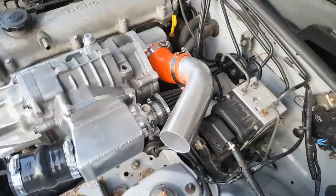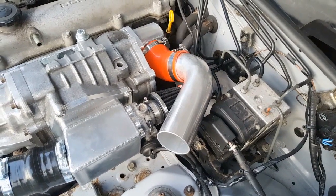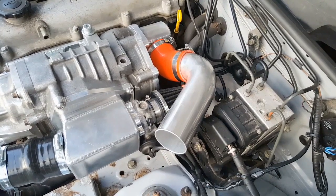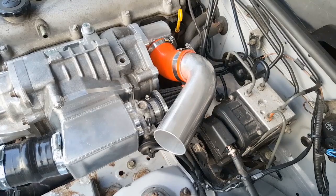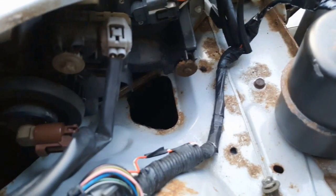With that out of the way, let's get this intake piping installed. Let's start with the air filter to the supercharger section. Part of this was actually included in the G19 kit — the red 45-degree elbow and the 90-degree aluminium pipe. With that installed, I just need to get from that section to the area behind the passenger headlight where I've chosen to mount the air filter.